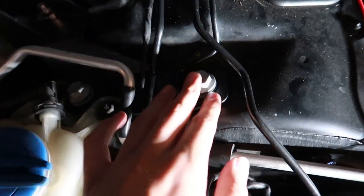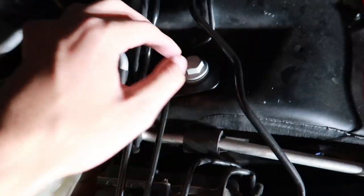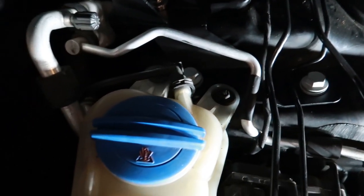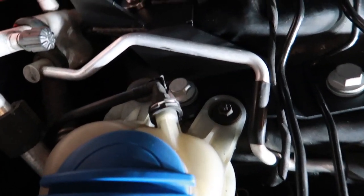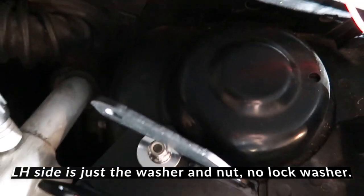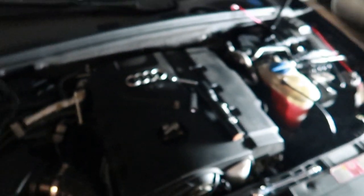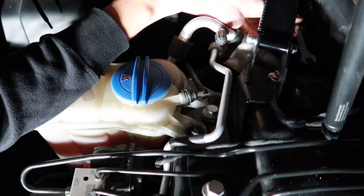After restoring the thread I put the bracket in — I didn't fully tighten it yet, it's still a little loose. Over here you're going to need a 10mm key because you can't get there from the top — it's right in the middle. The one on the other side you can get to with a socket, but that far one needs a key. Now it's time to put on the carbon fiber part.